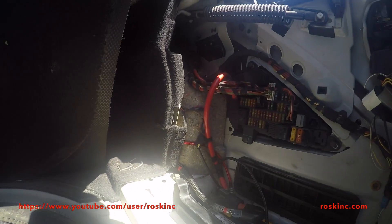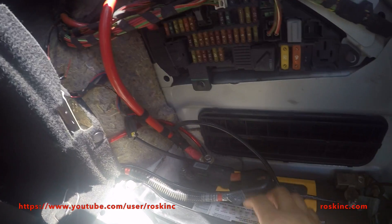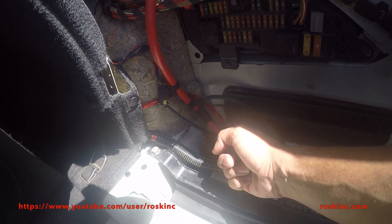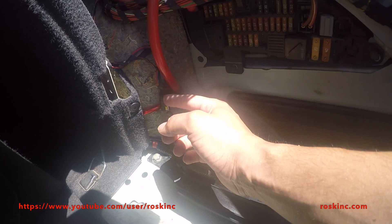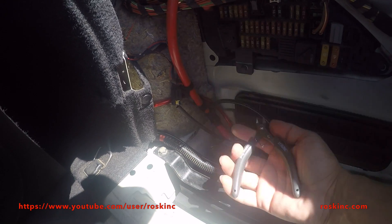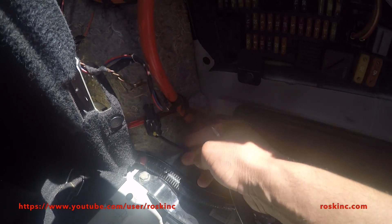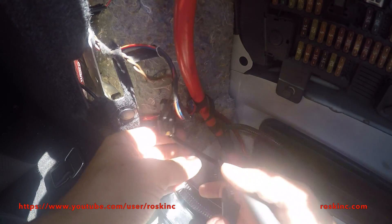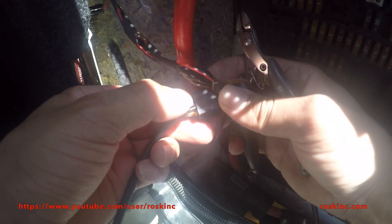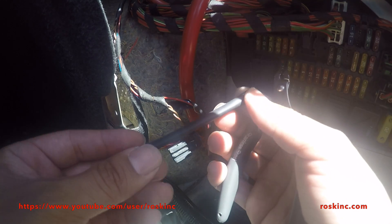You're just going to need some wire cutters. This is your BST cable right here. A lot of times the BST cable gets messed up when people change their battery and wiggle this thing around. There's a little sensitive fuse in here — if the fuse goes bad or gets hit, it will damage it. So the power will still work, but this little part won't. I'm going to show you guys how to do a bypass using a 2 ohm resistor. The cable is usually taped up here — this one right here — and all you have to do is just snip it here and unplug it.